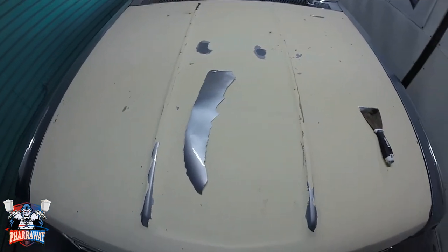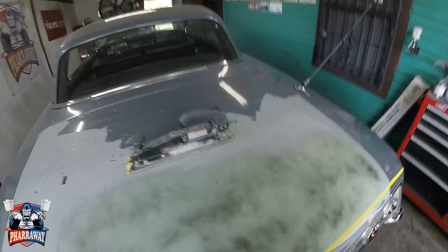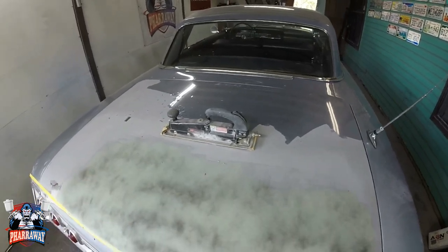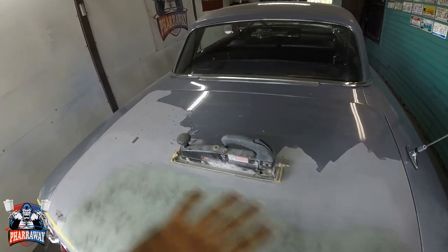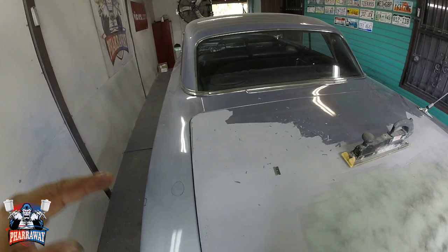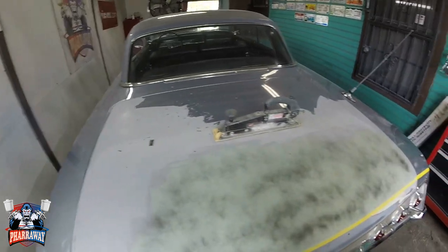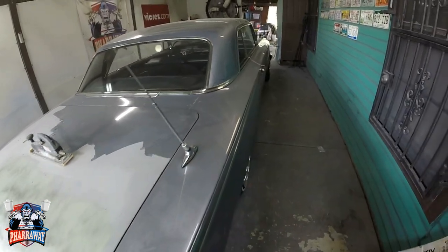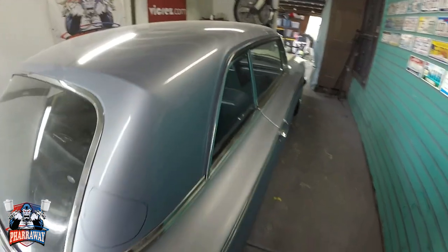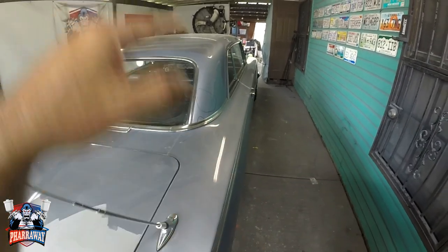Now there's a difference when you're doing a custom paint job. Between the layers on a custom job, you sand it. Let's say you apply some metal flakes — you have to sand a lot of layers off, apply more, sand again. You're keeping on adding more and more but sanding in between, eliminating a couple of layers on every pass for that special effect. That is different.